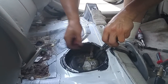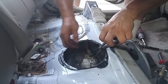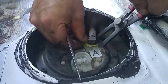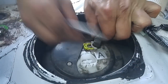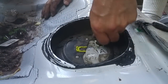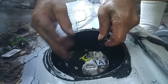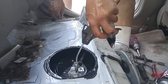Next we're going to disconnect the fuel line. It's still a little bit under pressure, so there's going to be a little fuel leak, which is fine — we'll just blow it dry. There's a pin down here; pinch it and pry it out. When I pull on this, it's going to be a fuel pressure release. There's the fuel leak — now I'll just blow this dry.